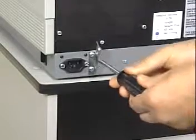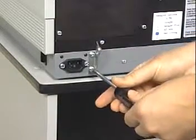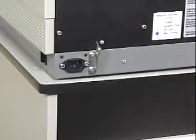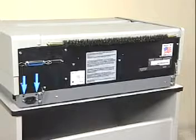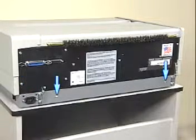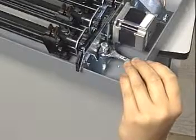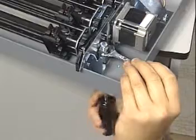After turning off power, remove the power cord. Loosen each of the 2 screws in the lower right hinge bracket 1 turn each. Do not remove these screws. Remove the 2 screws for the AC cover and the 2 screws for the shuttle carriage shafts. Set the printer so that the right front corner is off the print stand and open the case.